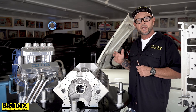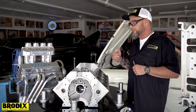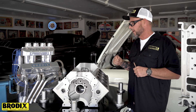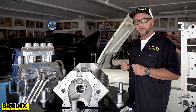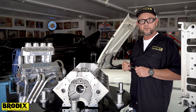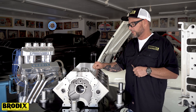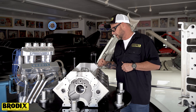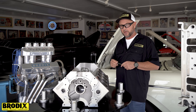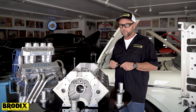It's offered with a raised cam and narrow pan, which comes standard, a 55 roller tunnel, which is standard, and the HIP process. The HIP process is hot isostatic pressure treatment, which makes this piece very, very strong — probably the strongest piece that we've had. This piece itself weighs 85 pounds without caps and studs, and with our steel billet caps on it, it weighs in at 102 pounds.